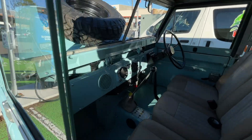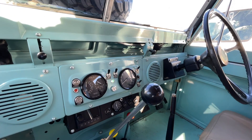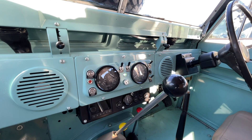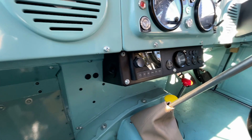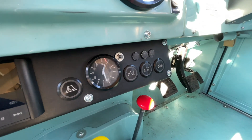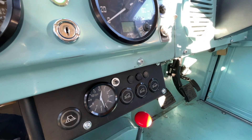Three seats in the front, of course, with a completely re-machined dashboard. We restore the original centre panel but replace all the switchgear — redesigned, rebuilt gauges, our design with Speedhut in the States doing them, so all digital systems with digital speed sensing. A whole new module below that houses all the electric vehicle controls: the different drive modes being off-road, standard, and highway — or almost a sport — really configuring the throttle response and also the regen braking rate and a few other systems.